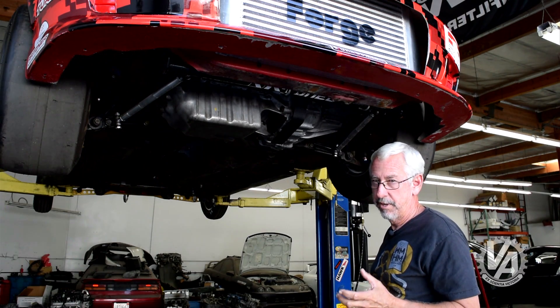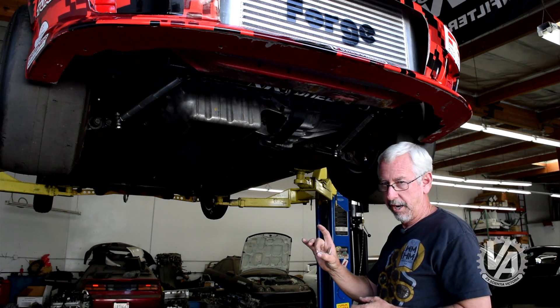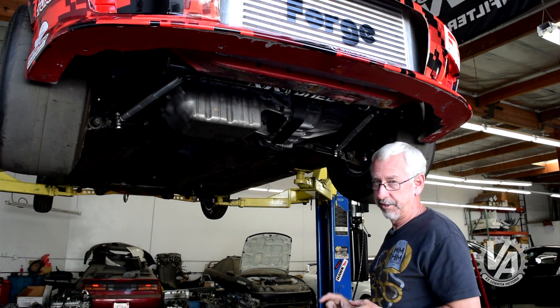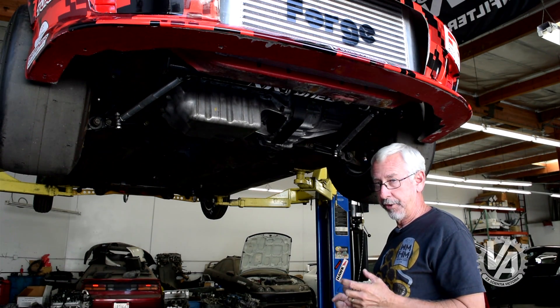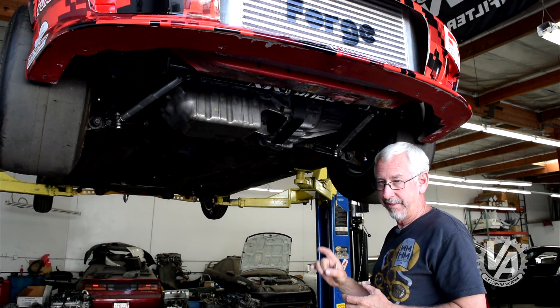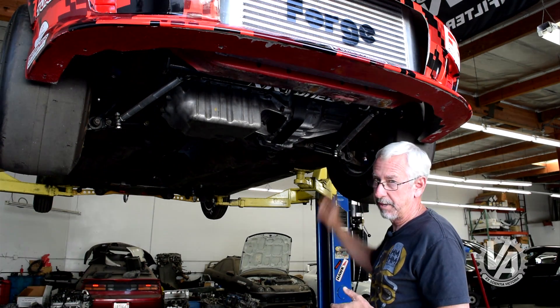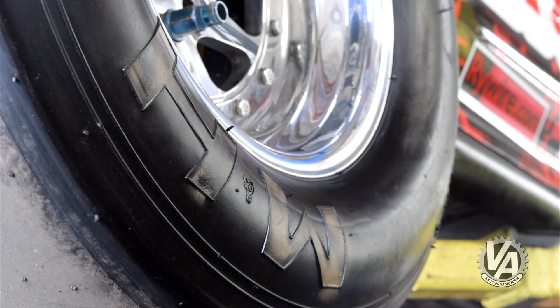Insane — that's the brand, not a description — the Insane driveshafts are designed to hold about a thousand horsepower. From there they go into custom ProDrive hubs. ProDrive makes a 36mm hub for this particular suspension, which is much bigger than the stock 32mm. That helps with strength where you need it, because the outer CV joints are usually the weak spot on these axles.